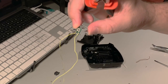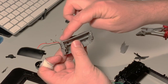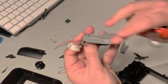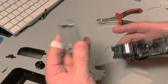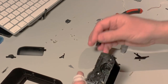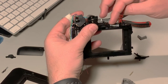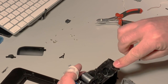The shutter button is for later mounting on the outside. If it doesn't fit, you can trim it down with a hobby knife or sandpaper. So now we have a battery box which will fit in exactly where we took it from. We just need to remember to reattach the little counter wheel — you attach it with the S facing out. If you put it in and it has a natural stop, that means you put it in correctly. We have to screw it into this hole instead.